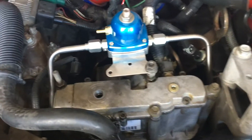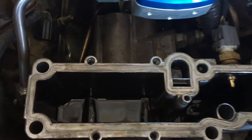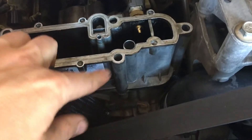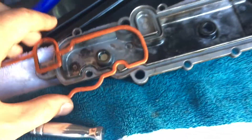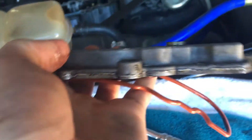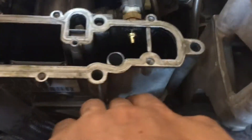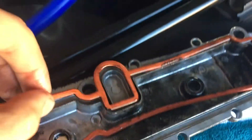I'm going to pull this off here and then join up with you guys again. We've got the lid off, the cover off the high pressure oil pump reservoir. You can see we drained it down. When you take off the cover, the bolts go all the way through and hold this piece on too. So you want to hold this piece down while you pry off the cover. What I found worked really well was just putting a little razor blade in between there. Here's the gasket that was on there — just putting a little razor blade between that and that while I held down the cover with my hand and then just prying up and popping that free. So now I've got a new one of these from Riff Raff, so that'll be replaced.